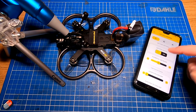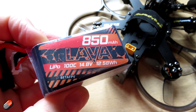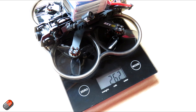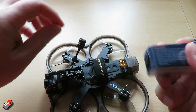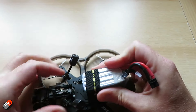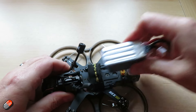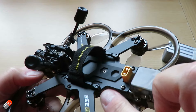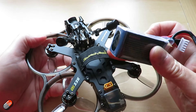The battery you're going to need is 650 to 1100 milliamp hours. I'm flying mine with one of these batteries — this is the Lava 850mAh, and this is taking just over the 250 gram limit. Flight times, they reckon, can vary from five to ten minutes depending on the size of the battery. There are two ways you can mount the battery on top: you can mount it in the standard space, or by undoing the two straps and rotating them, you can actually mount the battery side-saddle. I think that's a fantastic and really cute piece of design from SpeedyBee.